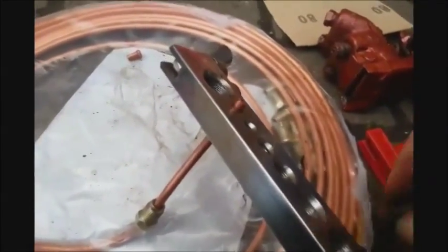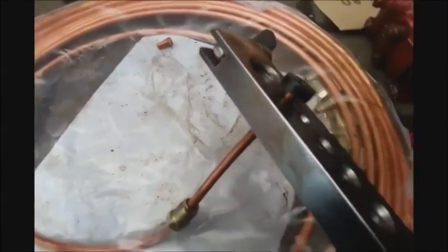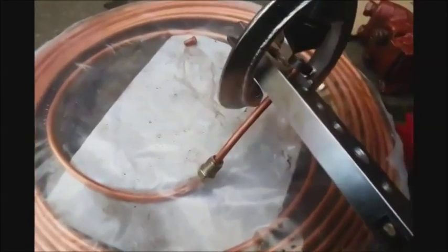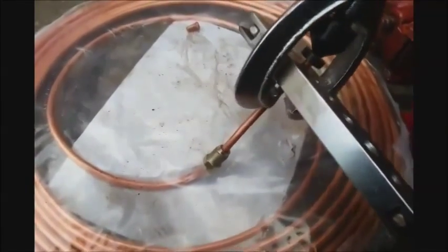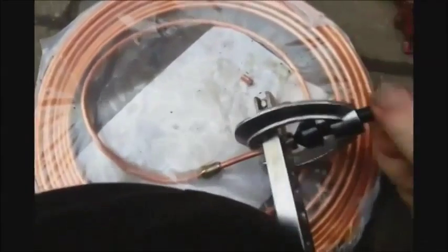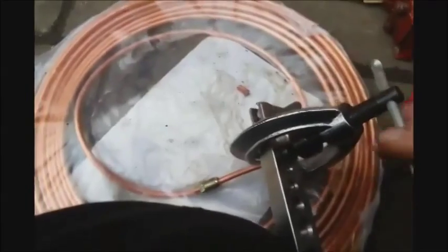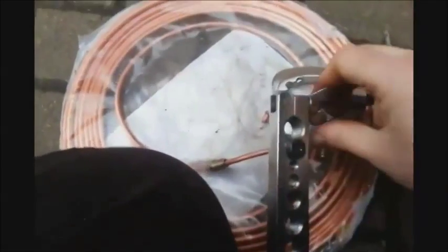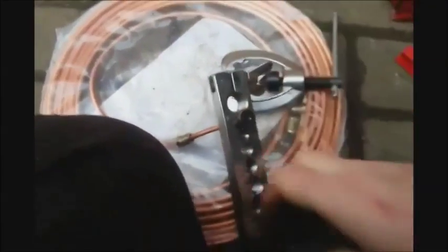It's all the way down tight, then you back it up, take the tool away. On the end of this pipe we have a nice flare, and that will now sit up against the fitting. If anybody's wondering why this is painted, it's just to stop the rust. That's the job that needs to be done - there in the dark where you're not going to be able to see with the camera, which is why I did it out here so you can see what I'm going to be doing. Except there's going to be much more cursing. We'll see you again.